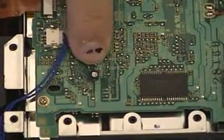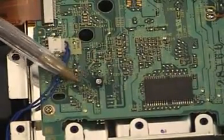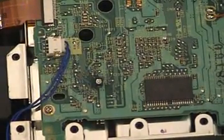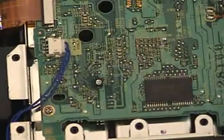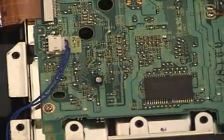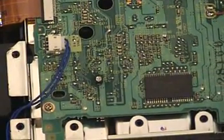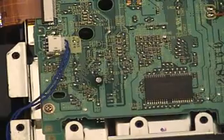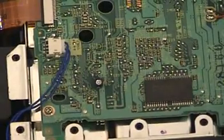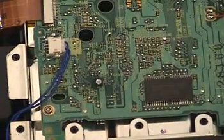When you adjust this, look at the size of this potentiometer compared to the tip of this pen — it is very small. You're going to need a very small screwdriver to make this adjustment. Even just tapping on it will adjust its value, so be very, very careful. I'm going to adjust mine off camera closer to about 195 or 190, then put the cube back together and test it. If your ranges are too out of whack, you'll put too much stress on your laser and risk burning it out or wearing it down faster — so you've been warned.